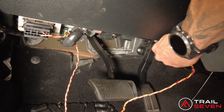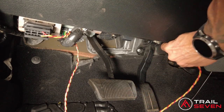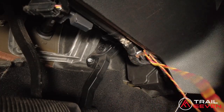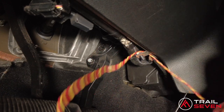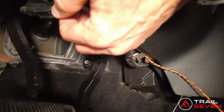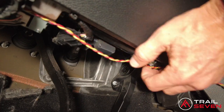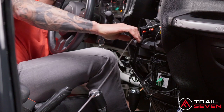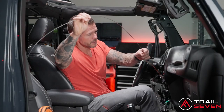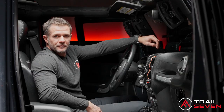And then above, over here, there's a bridge on the dash, the lower dash. You can run the cable across that. Go ahead and feed the cable through, and you'll be able to tuck this nice and neat right behind the dash lip. Now that you have attached this to your fish tape or hanger, whichever you have handy. All right, now we're back.